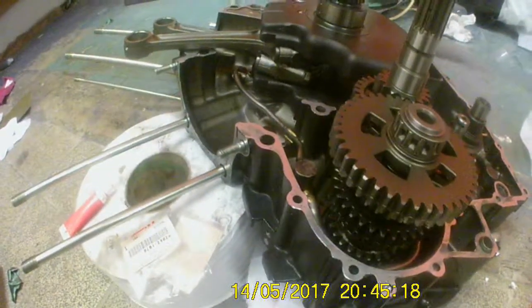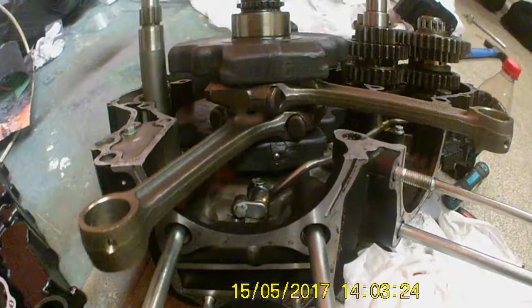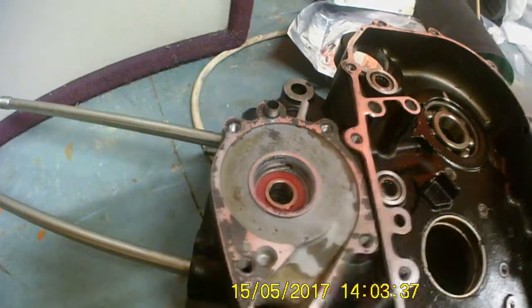Right, now them little needle jets are done. Over to this side, I'll put the first bearing in. Second, oil seal. Third, roller bearing — so it goes in that way round. So what we've got here is the engine half put together. Everything seems to be okay with it. I've got the sealed bearing in that side and the roller bearing in that side, with the oil seal in between.